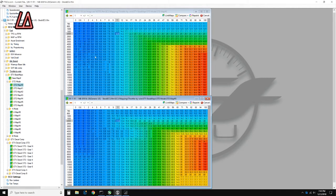Just grab my image if you have a 2009 R1, use my Standard mode maps, and see how you like them. To edit the cells: you click on a cell, then hit the plus key on your keyboard to add fuel — one press adds 1% of fuel. You can also specifically type in a value, for example 0.6, and it adds that amount. Hit Enter and it moves to the next cell.